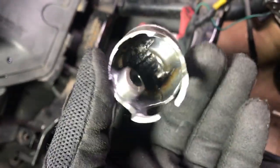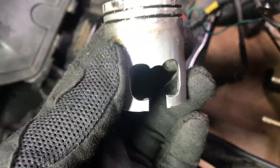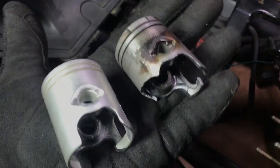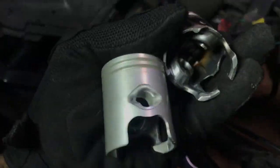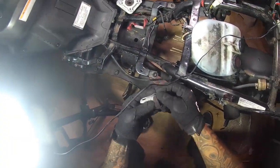Now we finally see the damage — a full 360 view of how badly this piston was damaged. It broke from here; this is the back skirt piece I recovered. The front of the skirt broke right here and that center strip is what's lost — it either disintegrated or it's somewhere inside that casing. Honestly I'm hoping it disintegrated. Look at those bearings. The one on the left is what it should look like brand new, the one on the right is the damaged one.